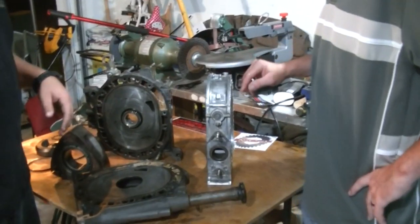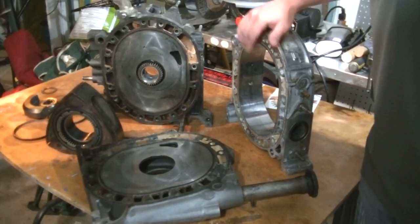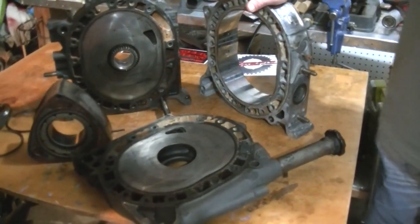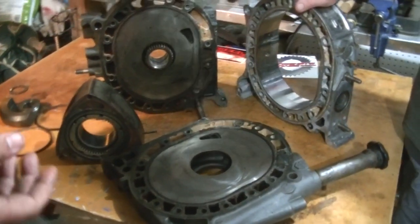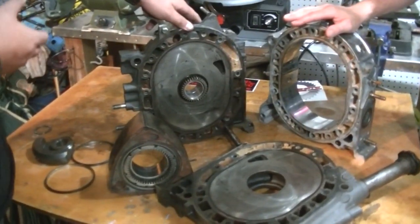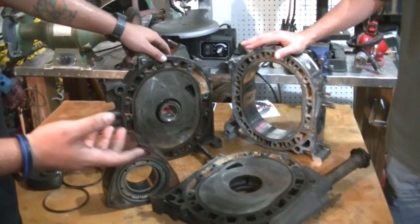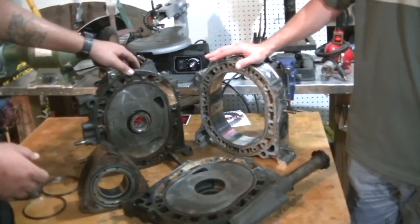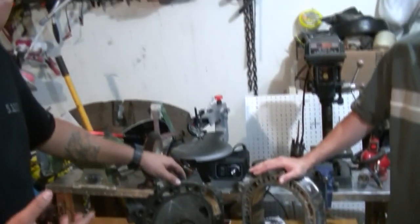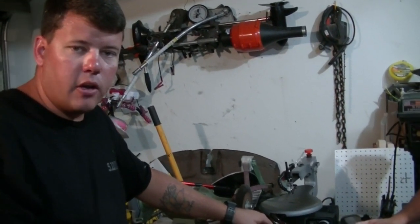So continuing with the two-stroke theory, just a couple more quick questions before we wrap this up. First off, you were saying that these exhibit a two-stroke-like power band. You want to expand that? Yes, exactly. So the rotary engine, a lot of us can jump into our five-speed cars, get your engine RPM up just a hair, ease off the clutch, let the clutch come to full engagement, and begin to accelerate. Rotary engine doesn't like that. Anything below, I'd say, 2,000 RPMs, it's going to spit and sputter, and you're going to feel every bit of the exhaust and intake overlap.